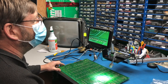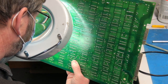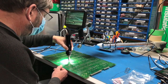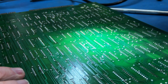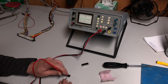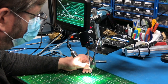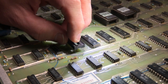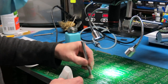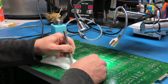Speaking of valuable, next we need to take a look at the issues with the game board. For something this technical, we've taken the PCB over to our buddy Andre's place to have a look. He's got a sweet setup and is far more capable to repair the issue than Josh or I ever could. Plus, the guy works on missile guidance systems for fighter planes for a living, so who better to do the work? Sure enough, after a bit of testing, we discovered that Josh's hunch on the RAM issues was correct, so Andre swapped the old RAM out for some new chips. He installed sockets first, so these chips could be replaced with minimal effort if they were ever to fail again. Andre is an absolute beaut, and we can't thank him enough for the amazing work he does for us.